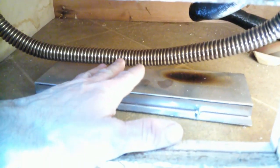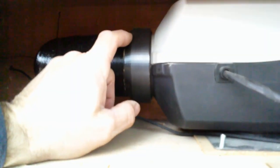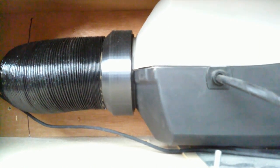Now I'm seeing some discoloration on there which tells me I definitely have a pinhole in my exhaust tubing, and that's why I found it so important to keep the chambers separate. This is where it's drawing air in from the RV, going through the heater, and blowing it back into the RV - so this being in a separate chamber makes me feel a lot better. Also, you may have seen a still image - this is a 3D printed adapter that screws onto the nose of the heater. I believe I uploaded it to Thingiverse when I first designed it and it might still be there.